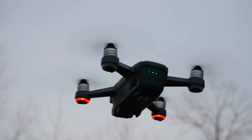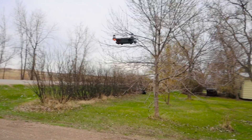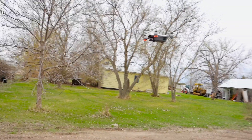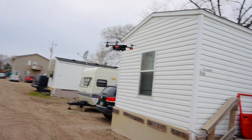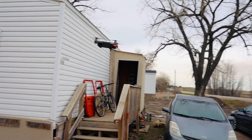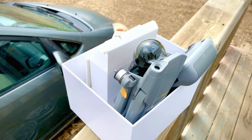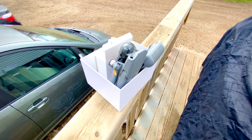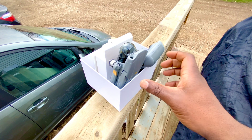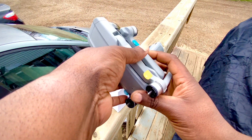That hibernation mode allows the battery to be stored over a long period of time without causing any damage. These lithium-ion batteries, especially for the Mavic Air and also the Mavic Mini, have been known to swell over a period of time if left in storage while fully charged. There have been some improvements, and the batteries that come with the Mavic Air 2 have these incorporated. For example, if you have the battery fully charged and it's left idle for more than 24 hours, it discharges itself to 96%.